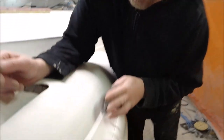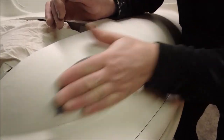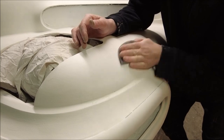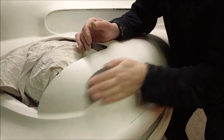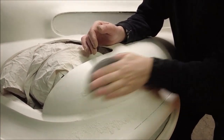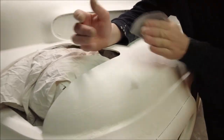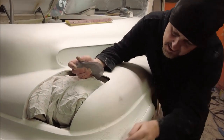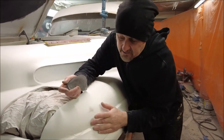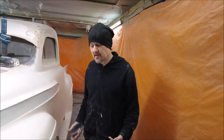With this piece of 120 I can feel there's a lump about there. There you can see that high spot that I could feel coming through there. What this does - particularly when the block goes over this - it will take that out. We can already see there that where there was just pitting, scratching, and roughness, now there's just chalky smoothness.